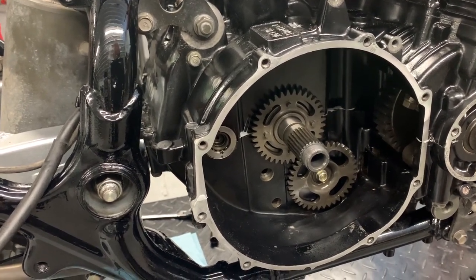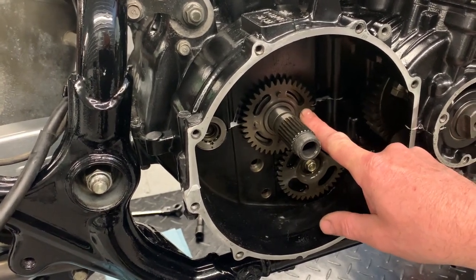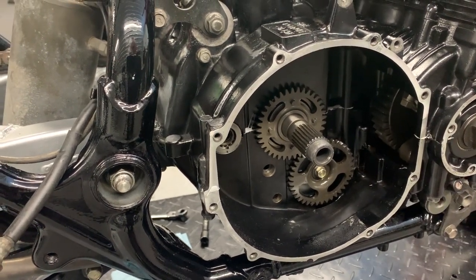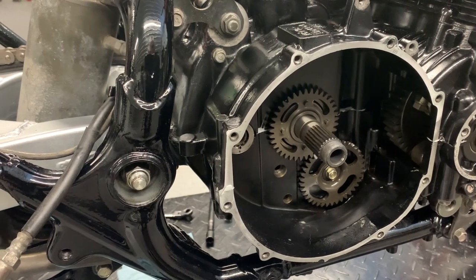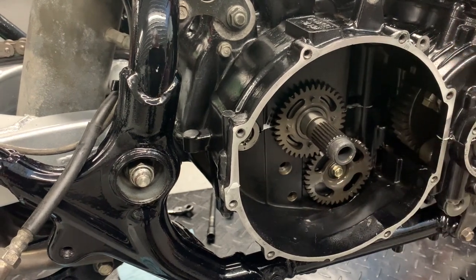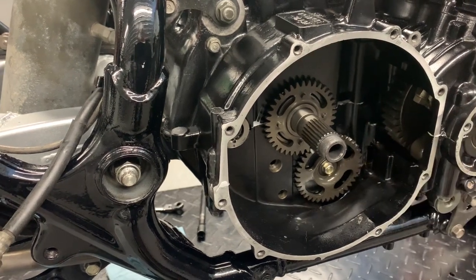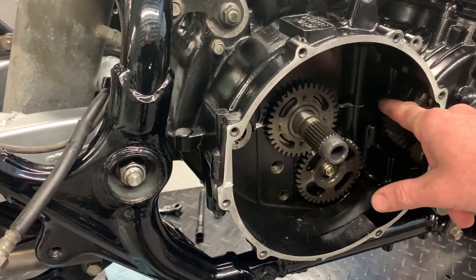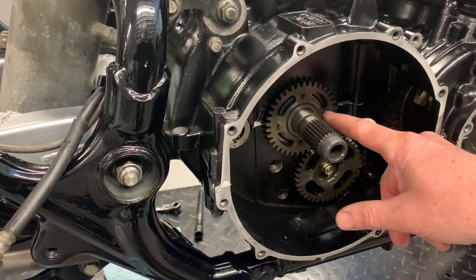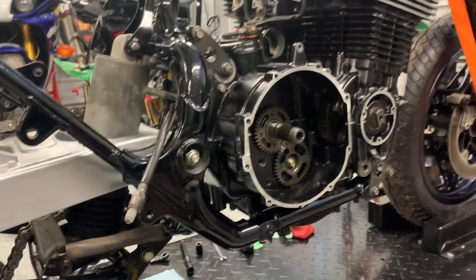And so the trick is to get that outer assembly aligned so these get properly fitted. And also, there's those larger outer drive gears on the clutch. There's a double set and they tend to kind of scissor. So you have to get them to align to mesh with this gear set right here. So you got to move those with a screwdriver, and then kind of maneuver this, I think, with a screwdriver to make sure that these are seating into the back of the clutch. So we'll see how that adventure unfolds.